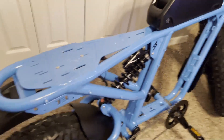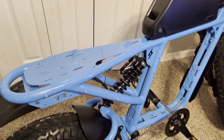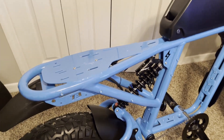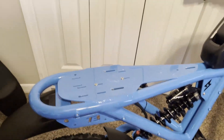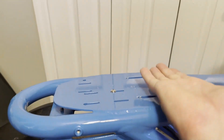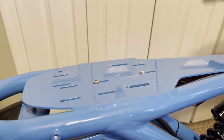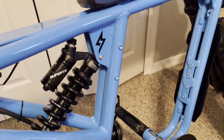It's a huge controller for this bike, but I'm not going to be running 32,000 watts — I'm only going to run somewhere around 22,000–23,000 watts, and even then the amount of time it'll run at that is very limited, so I'm not really too concerned with heat. If I am, I'll probably do a liquid-cooled setup — put a heat sink on the bottom of this plate and liquid cool it. Or if I really want to keep it basic, I might even mount the controller over here, though I really want to keep the bike looking stock.